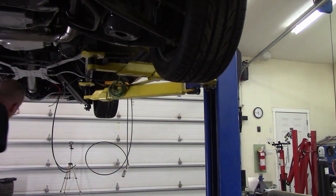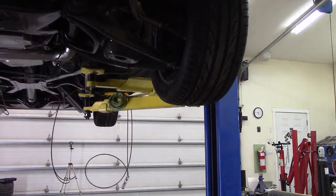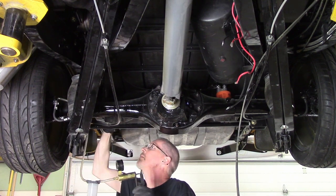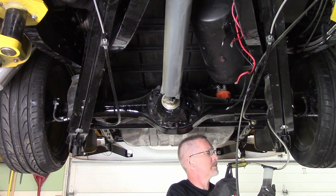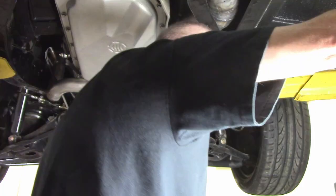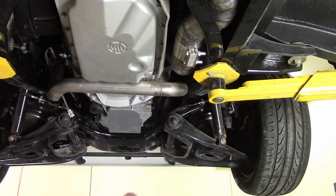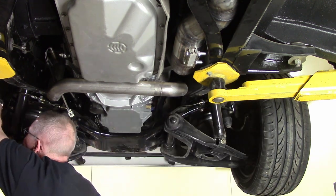I knew it was love when my sweetie was willing to sit in the car and help me bleed brakes. However, I'm working on my own today — everybody's out and about. This is just a cheap MightyVac equivalent; it creates a vacuum and pulls the fluid through the master cylinder all the way through all the brake lines. It took a long time to get it started but went pretty quick once it was going. It's got a good solid pedal feel — I may bleed them again just to make sure. I have bled brakes by myself with engine vacuum before, but this engine doesn't run yet.